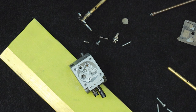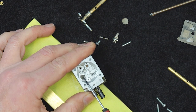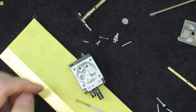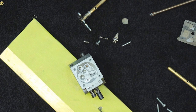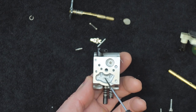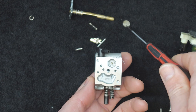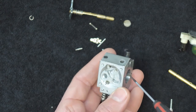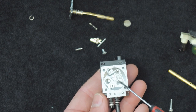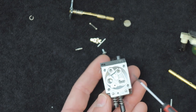There's the second Welsh plug out. There's a little screen under this one - it's got some dirt in there. There's a new one in the kit, and a little screen as well. The fuel pump gets pulses from the engine to supply low pressure fuel through the screen into the metering side. The bits we pulled out meter the fuel into that area - I'll show how that works in detail on assembly because it needs some adjustment.